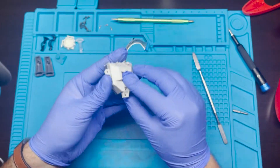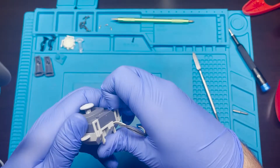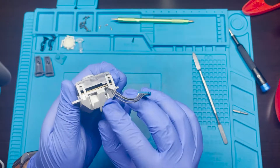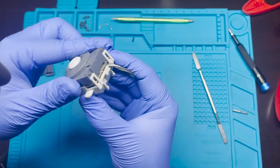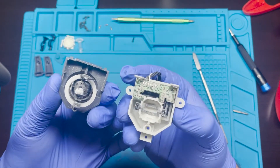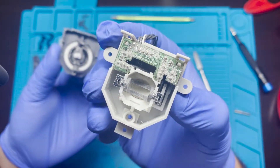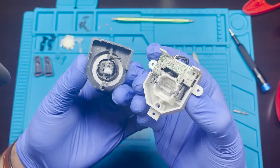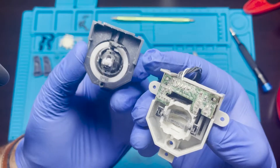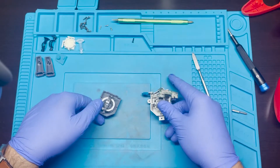You can see it's trying to spring open. We're simply just going to lift this up a little bit so we can start opening it up here, and I'm just being real careful because I don't want it to open up fully. So you can see it's already open — I'm holding onto the two pieces. Once we open it up, you can kind of see the mess that's in there — all that powder and plastic that's just been rubbed out causes this poor contact. So we're going to go ahead and clean all this stuff.